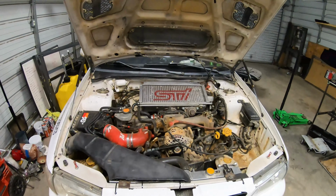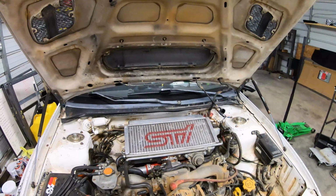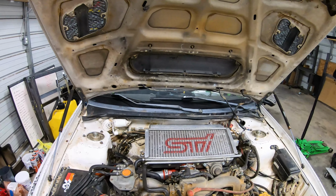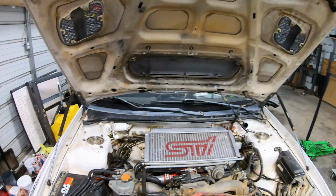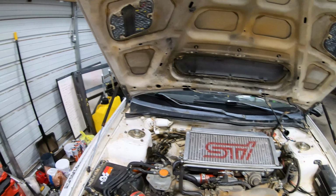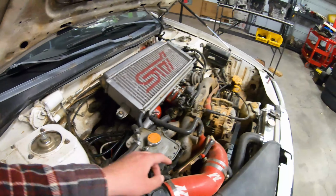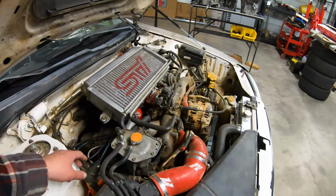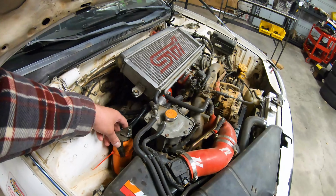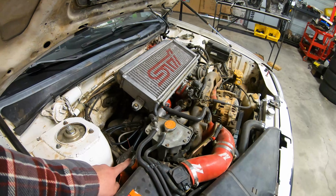This car did not have anything on it. We have a Killer Bee AOS on the way to replace our old one, but currently we didn't have anything on the car and we ended up getting some blow by and some smoke. So we quickly pulled off this line, which is where we saw some of the oil coming back in. We vented it to an energy drink can, just kind of zip tied out of the way to see how much oil was coming out and kind of do a quick study.